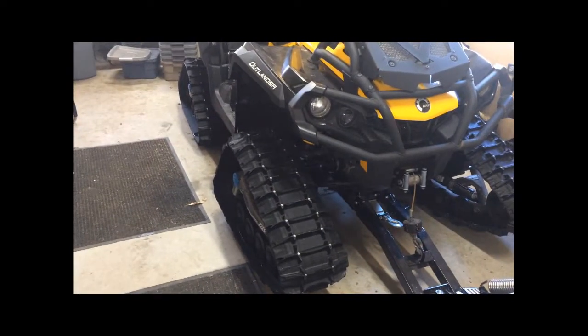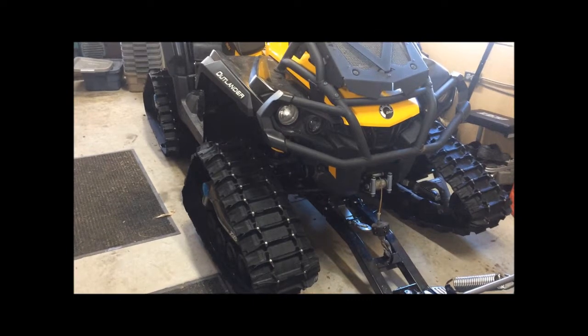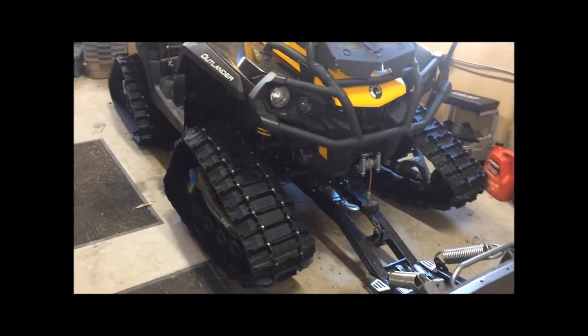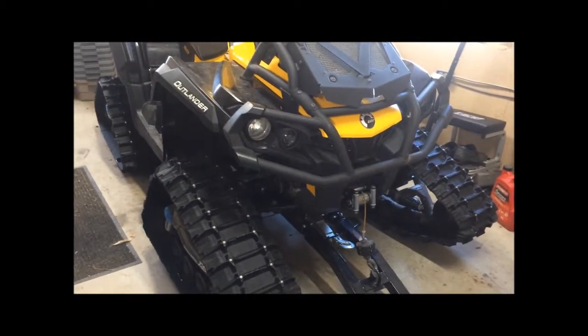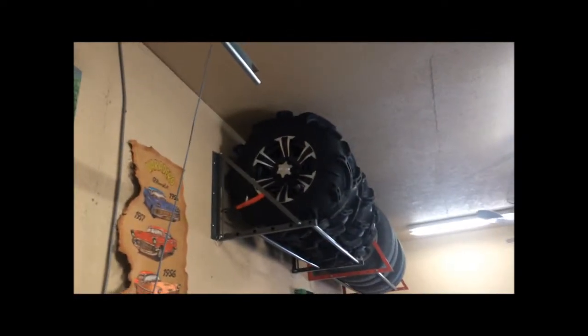What happens is that the water builds up in the bearings and they start to rust, and then you've got an issue. So basically what I do every year before I put them away, I pull all the caps off, let everything dry really good, throw all the caps back on, then I store it again in a vertical sense. Of course, wheels are stored up for the winter.